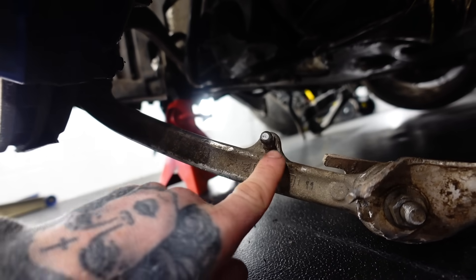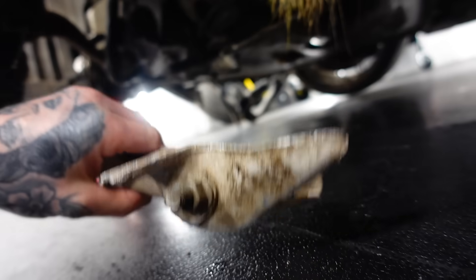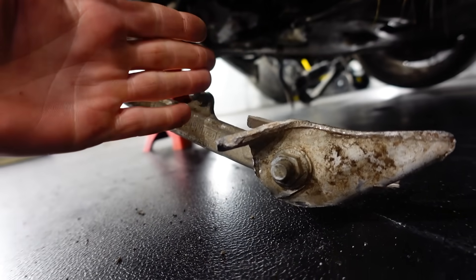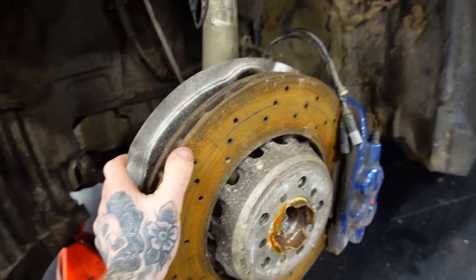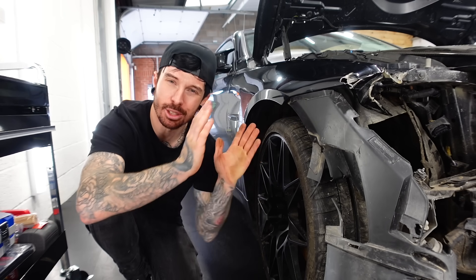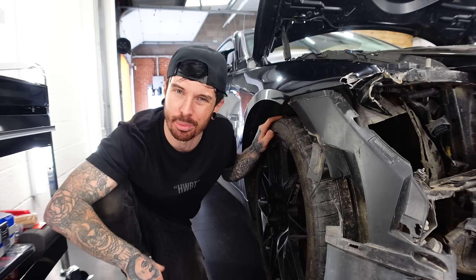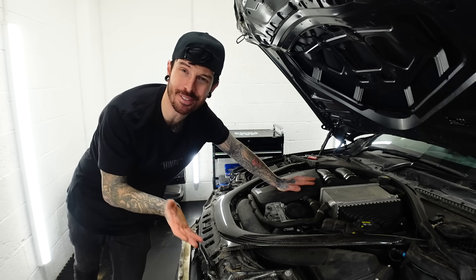The only problem I can see - which is a bit of a pain - is this suspension on here bolts to the subframe, which is over there. So the whole subframe will need to be dropped, lowered and changed. The track rod is completely popped out and free to do whatever it wants. There's also suspension damage on the driver's side because the wheel is really far covered in. On the interior, the steering wheel airbag's gone, the dashboard airbag's gone - which has also smashed the front screen - and the curtain airbags have gone as well.